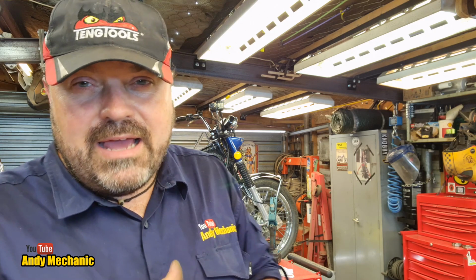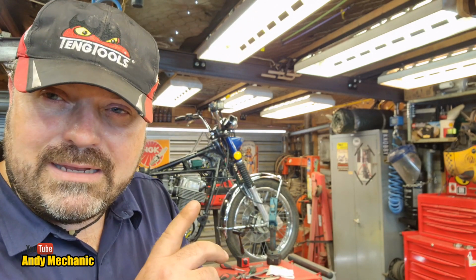But the bike has had a complete rewire on the primary circuit. It's had a new ignition relay fitted, which didn't exist before, which then prevents the current for the primary circuit for the coils going through the ignition switch and through the kill switch. It has a direct feed. A lot of the wiring was old, it was corroded. There were so many bad connections on that particular circuit as well. So all that's been replaced. It's getting a direct feed from the battery now, and it's got the new Dyna coils.